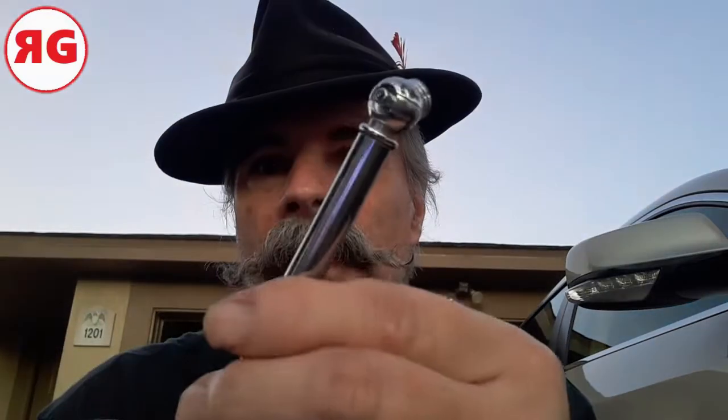Now, if you put too much air in, no big deal. That little valve thing, you can see the little pin in there. Well, this tool, you can see where you push it in to see how much air you've got. Well, on the other end, it's got this little knobby on it. Now, you can push this into that air valve, and what that'll do is release some of the air. So if you accidentally put in 38 pounds of air, you can release some air.